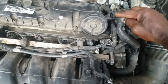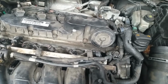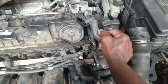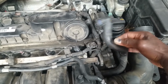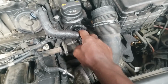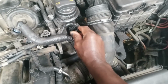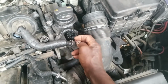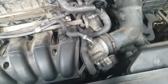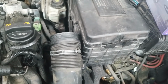If there's a problem, because it's an O-ring around there and sometimes gets a little stuck, you can spray some lubricant on that and work it out. Once you have that out of the way, there's a little piece that holds it down onto here. Disconnect that. And over here, it locks into this U-shaped piece right here. Well, actually, it's a circle. If you press them together, they will lock. But if you put a screwdriver under here and pull it, you can dislodge that. And this piece right here was connected to the cover that I just took off.